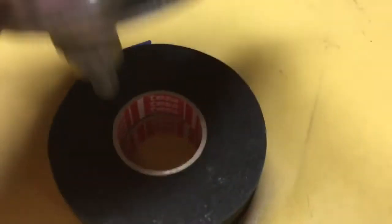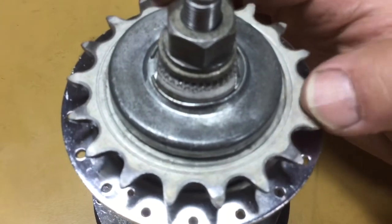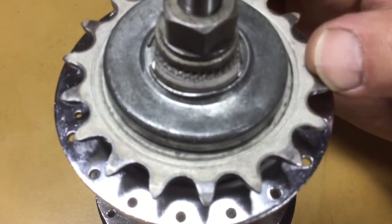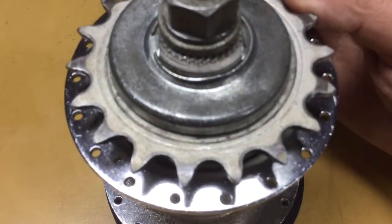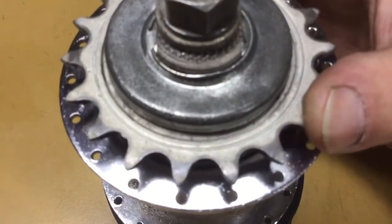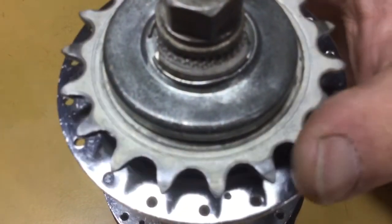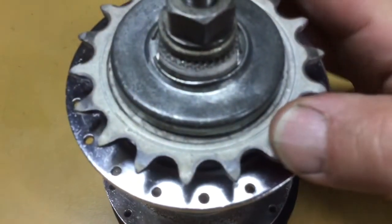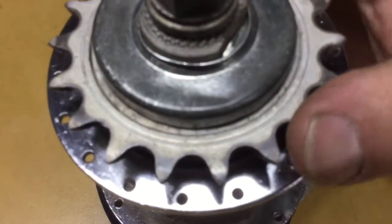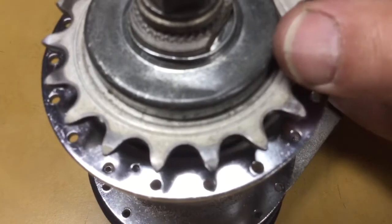I'll use a little stand here with some cloth electrical tape to set the hub up so you can see. We are in high gear here — you can see the holes for the spokes, the sprocket and the hub are rotating in unison. Now they are rotating in low gear — you can see very clearly that the sprocket is overrunning the hub. I haven't worked out the exact ratio, but it's something like a 30 percent decrease. That clicking you hear is the indexing mechanism.